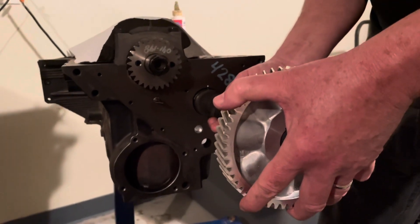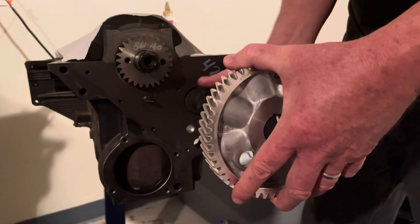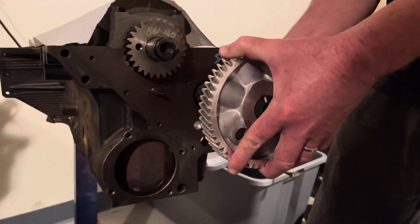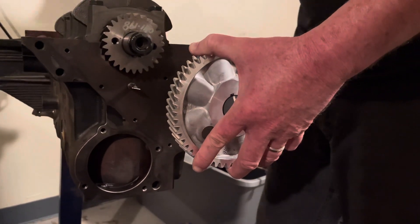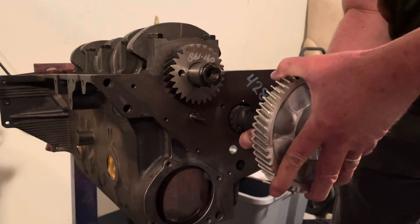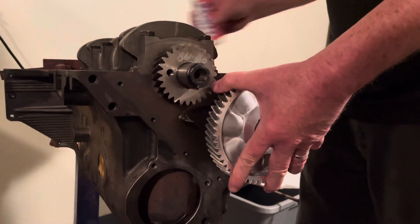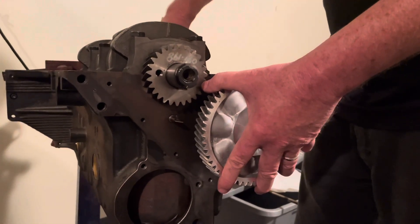Now I'm having a little trouble getting it going. There we go — just went in, went in pretty easy. Don't let go of it — it'll slip right through your fingers. That's the second journal. I'm going to keep going until it's all the way in. You're going to hit stuff, just go gently and easy and it doesn't do too much damage. I can move the tile out of the way and look down to see where the cam's at. Now I'm reaching down with my fingers and lifting the cam slightly to make it easier to get through. Now I'm to the front journal — I'm going to lube it up and then work it in the rest of the way.